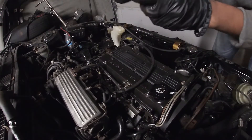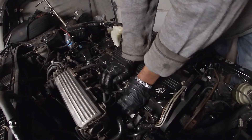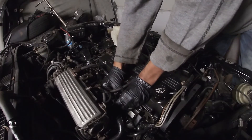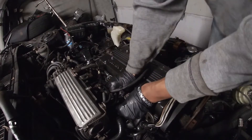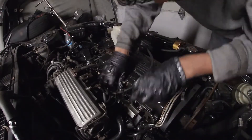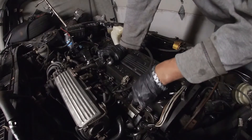I got the fuel rail bolt out, going to take out another bolt. That first bolt was a 17 millimeter banjo bolt, and then there's another banjo bolt which is 12 millimeter. Make sure you don't lose the washers on these. Got the banjo bolts out. Then I'm gonna get the fuel regulator bolt, which is two 10 millimeters, and then three 12 millimeter bolts and the fuel rail should come up.